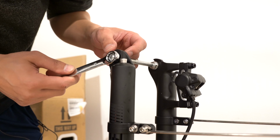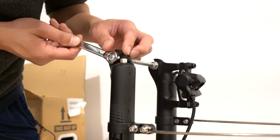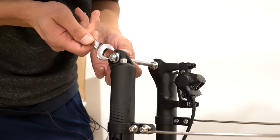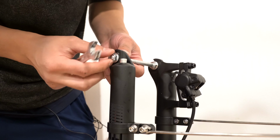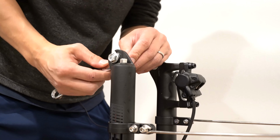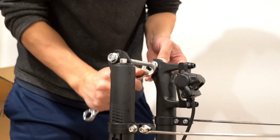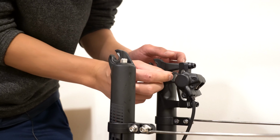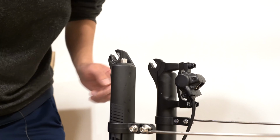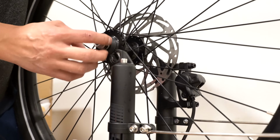Of the wrenches that it came with, this is the smallest one, it's a 15 millimeter, and this side doesn't quite work. If you use this side, there's enough bite to loosen this. We'll do it on all four sides to get this off. We'll remove this tape from between the brake pads. On the tire itself, we'll loosen these nuts on both ends.